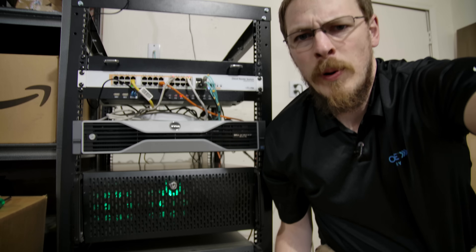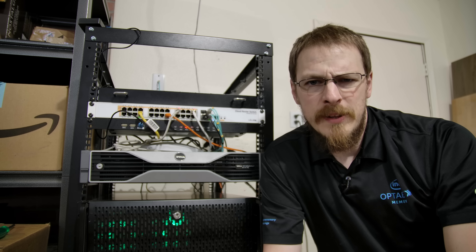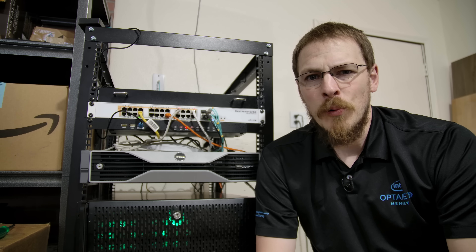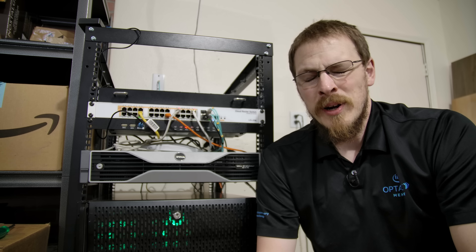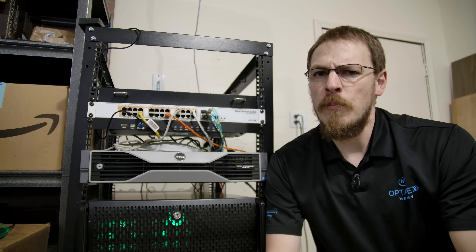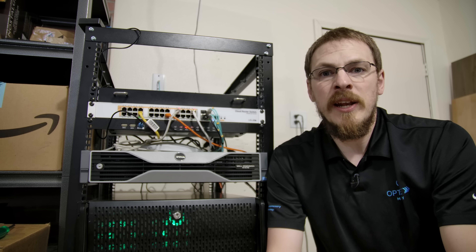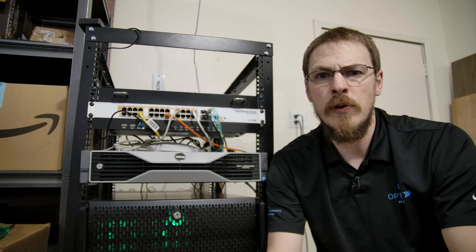Last but not least, all the way at the bottom of my server rack — that is my FreeNAS box, and it is definitely the redheaded stepchild of my rack. Not that it's not a fully capable server, but it's the only one not running server hardware — in fact, it's running pretty low-end consumer hardware. It's a Z370 motherboard with an i3-8100 4-core, 4-thread CPU and 32 gigabytes of 2133 MHz memory. As far as the storage array goes, that's where I'm running some enterprise hardware: an LSI 9201-8i host bus adapter as well as six 6-terabyte HGST helium enterprise SAS drives. I do have two 120-gig SSDs in a ZFS mirrored configuration for my boot disk, and the HGST drives are set up in a RAID Z2 configuration — the equivalent of RAID 6 — giving me a two-drive failover point.